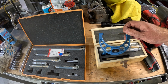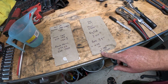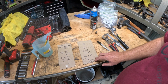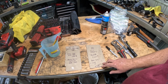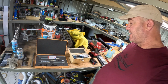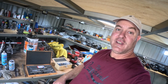But these beauties here are pretty straightforward to use, measuring external diameters. So the standard bore is 91mm. I've got 91.059mm or 3.585 inch. So it's standard bore, and I should just be able to get a standard set of pistons, seeing as there's almost no wear on the bores. And that's where I'm at. Probably won't get another video for a few months, but thanks for watching, and I'll see you next time.